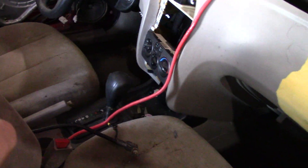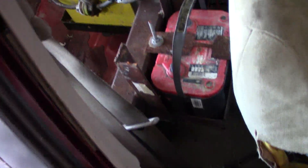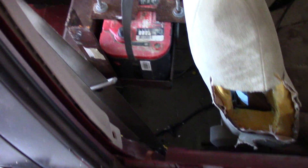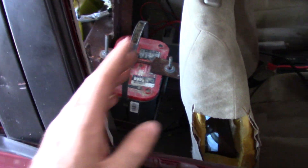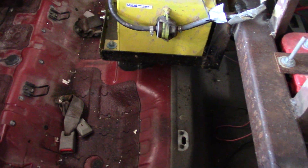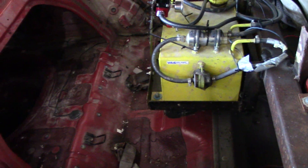We left the passenger seat because there's no bar here — we're running a seat bar only. Keeping the seat there means the door pushes in and catches on it for a little more protection. That's also why we have the reverse battery mount setup — the battery sits backwards on the seat bar between the seat, keeping it floating in the air instead of being in a hole in the seat or on the floor. It's easier for me to reach during the derby. The floating gas tank is welded directly to the seat bar, so the floor can move without affecting the fuel system.